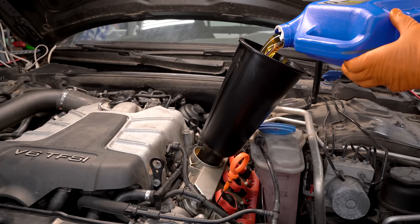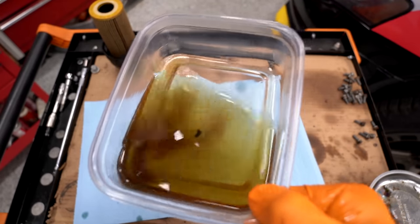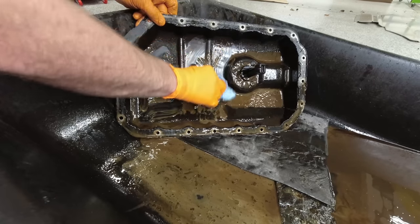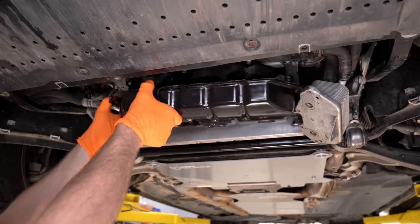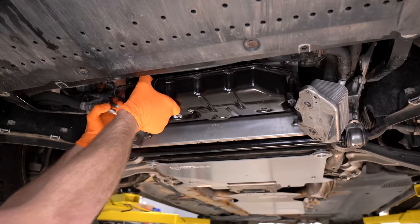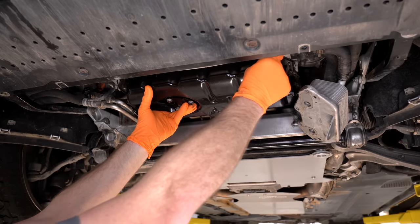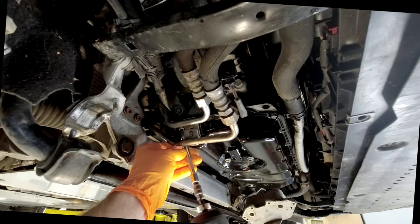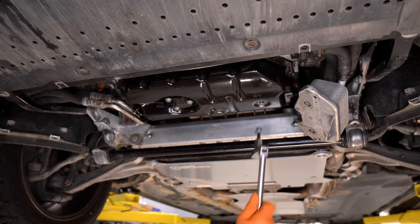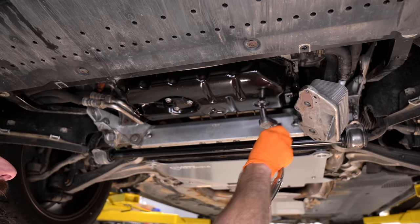This will consist of a series of engine oil flushes to try and get as much of this out of our engine as we can. We have some reassembly to do, but first things first, we gotta clean this nasty stuff at the bottom of our oil pan. I'm not even gonna clean the sealant off yet — we'll do that on the final time. We're just gonna put this pan on with a couple of bolts. It's gonna leak. We have the drip tray down on the bottom. A little bit of a leak is not gonna be a problem. We'll put the old drain plug with the old crush washer back in — no sense in wasting a crush washer.